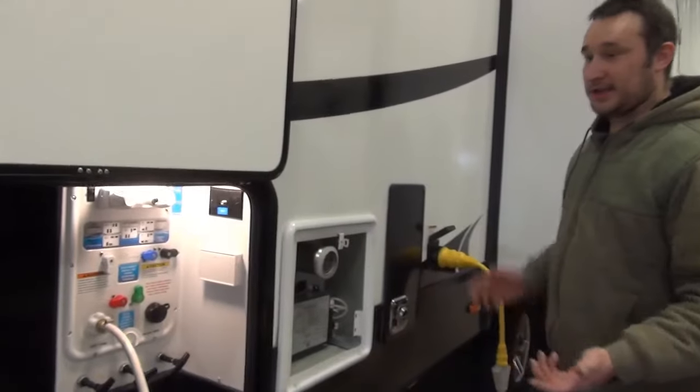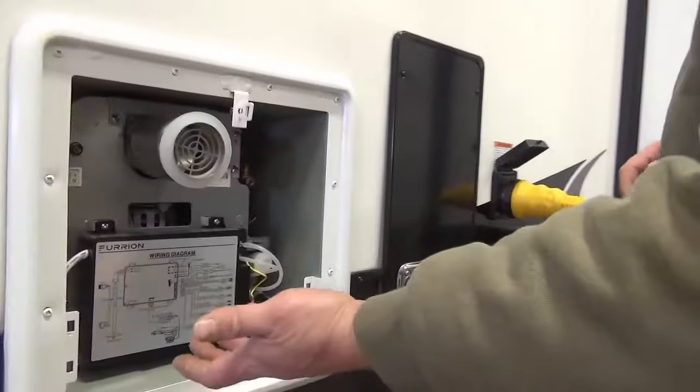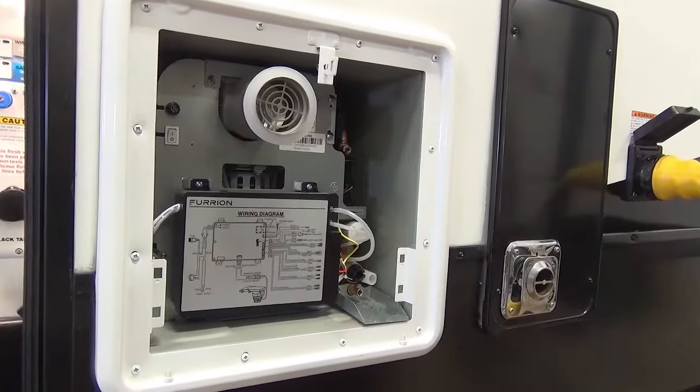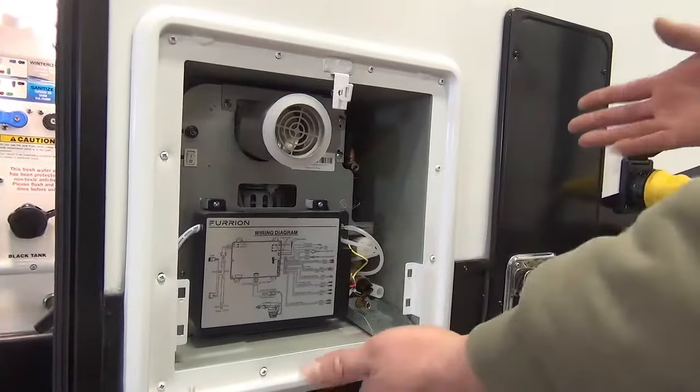So normally at this stage, I would show you how to put your drain plug back in your water heater. This is an on-demand system, so it's just these two little drain plugs here. I got them put back in already. That's really all that's needed. There's no bypass valves or anything to worry about with this kind of setup.